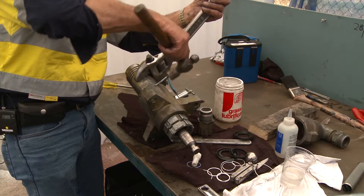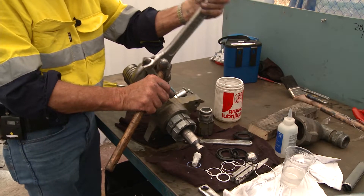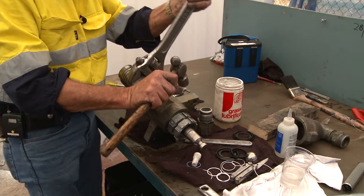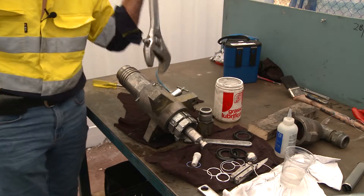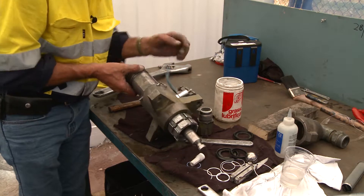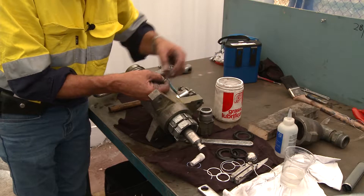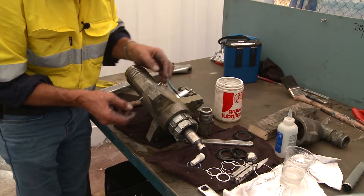There's no resistance at all. To ensure there's no resistance you can just keep moving it back and forth — none whatsoever. This pin does have a keeper hanging on the stem bolt, and there's a little retainer that goes on that. It's a bit of 316 wire that holds it in place so that if you do take the pin out, you don't lose it.